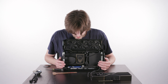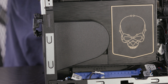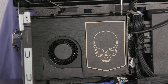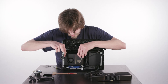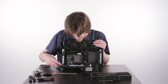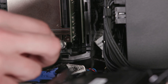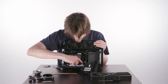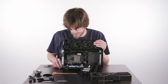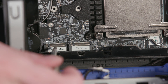Then in order to access the RAM modules, we'll need to remove this plastic baffle. There are two captive screws here. Here you can see the SODIMMs — this one has two installed. To remove them, I'm just going to press down that clip, slide it out, and the same for the other. You have removed the SODIMMs from the system. You'll see you have your additional M.2 locations here and here.